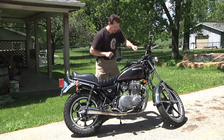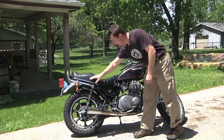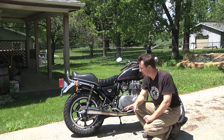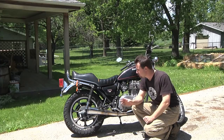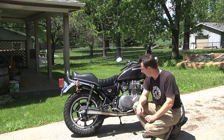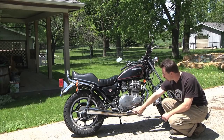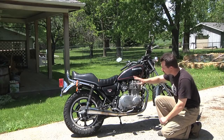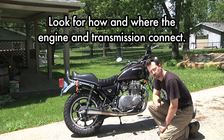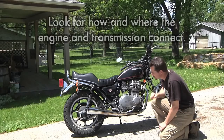Let's take a look at some of the individual characteristics. Right away I notice it has passenger pegs and a passenger seat. While that's not necessarily specific to weight capacity, typically if a motorcycle is designed to carry a passenger, it's going to already have the frame strength and suspension strength for carrying the additional weight of some batteries. Another thing I notice is the actual design of the motorcycle — a pair of tubes make up the frame coming down in front, and the transmission, engine, and other components bolt right into that, giving us a number of good attachment points for both the batteries and the electric motor.